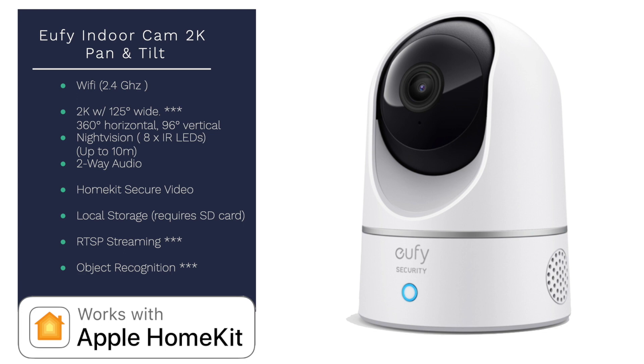But there's always a catch, and there is with this camera as well. As soon as you turn on the Apple HomeKit functions, you're going to lose some features. Your 2K is going to drop down to 1080p because that's what Apple HomeKit Secure Video supports right now. The RTSP streaming is disabled once you're in Apple HomeKit mode, and object recognition is no longer available. Interestingly, you still can have the pan tilt motion tracking — that will continue to work automatically even when you're in Apple HomeKit mode. So there are some silver linings here.